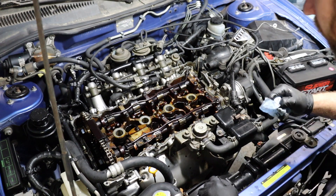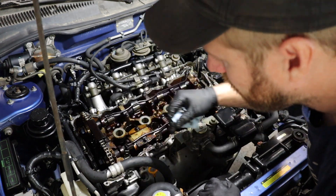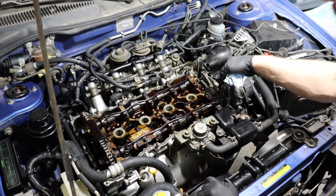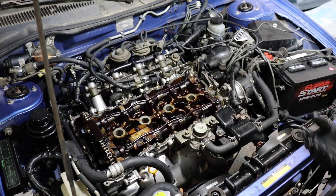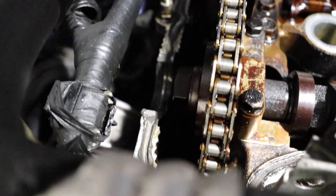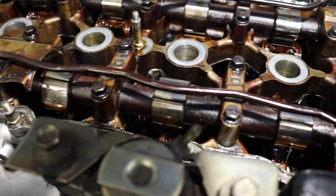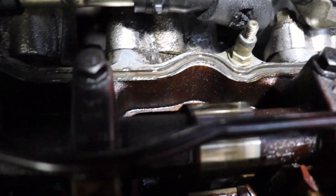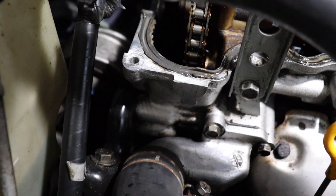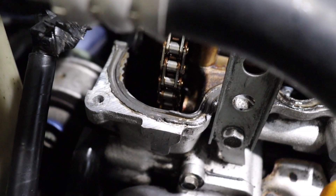A little darker than I usually like to see under here — probably been a while since the last oil change. The timing chain looks really good though. They put RTV around the entire thing, which — it's on you guys if you want to use RTV — I'm a big advocate of just doing it over the cams in the corners where you tend to see leaks. They went super hard on the RTV, which you can see around the entire valve cover gasket. You might think you're doing the right thing by using RTV, but it can actually introduce leaks as that RTV dries up over time. Much better to have a valve cover gasket torqued down correctly.